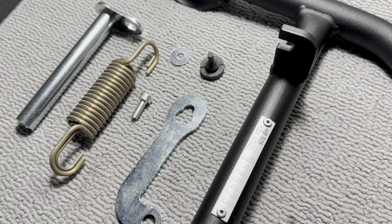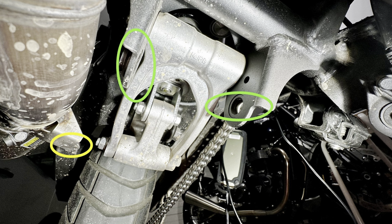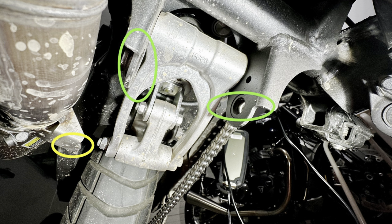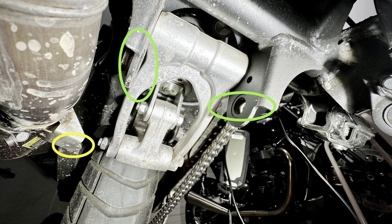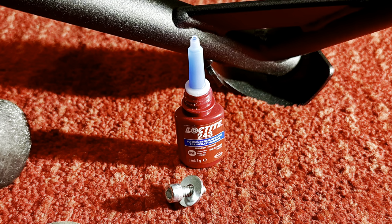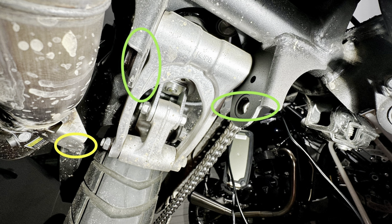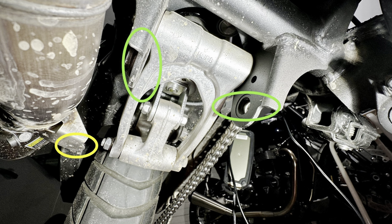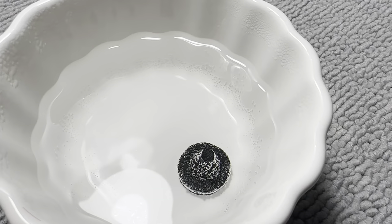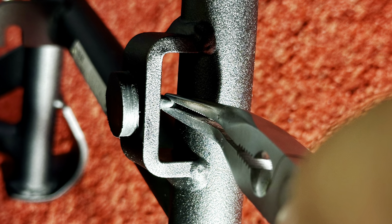Now for the install — it's hardly rocket science and the instructions are pretty self-explanatory. Locate the mounting holes under the bike, highlighted here in green, position the stand and slide the axle through. I was going to add a bit of grease until I noticed Hepco had already done so, which is another sign of their attention to detail. Slide in the greased axle and fix in place with this small bolt, not forgetting a dab of threadlock just to be on the safe side. A rubber bump stop is also provided in the kit, and this makes contact with the exhaust bracket when the stand is in its up position. This proved a little awkward to insert into the hole, so I soaked it in some hot water for a couple of minutes to soften it up, and with the help of some needle-nose pliers pulling on one end, it was an easy enough job to push it home with my thumb.